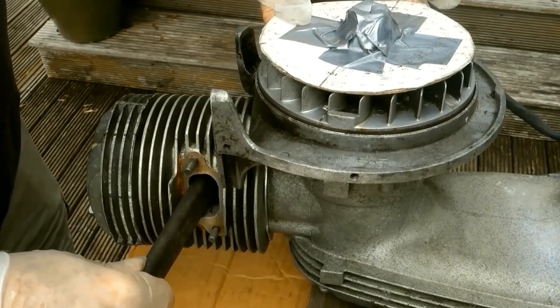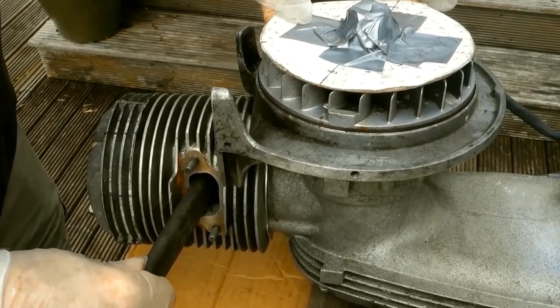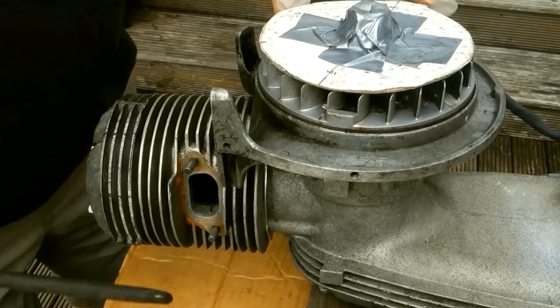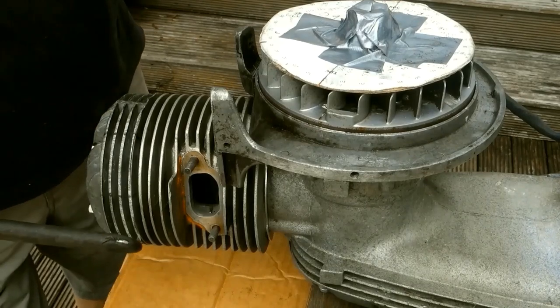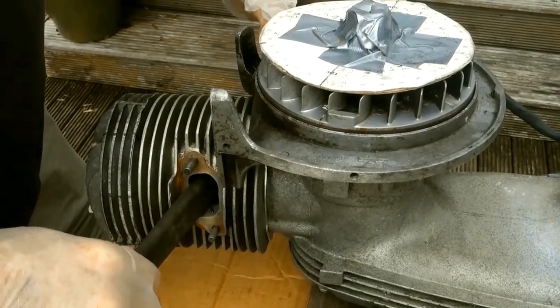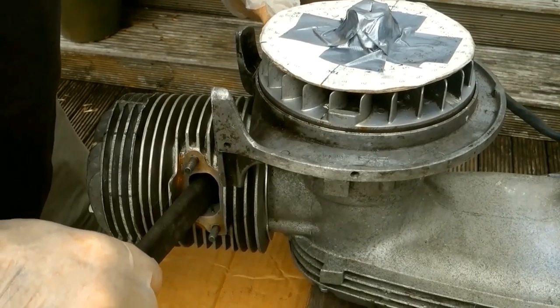It actually took a little bit of touchy feeling with the flywheel and a little cajoling, and it's now come in on my original top dead centre marks. I'm not sure if I could quite recommend this. You maybe need a double check.